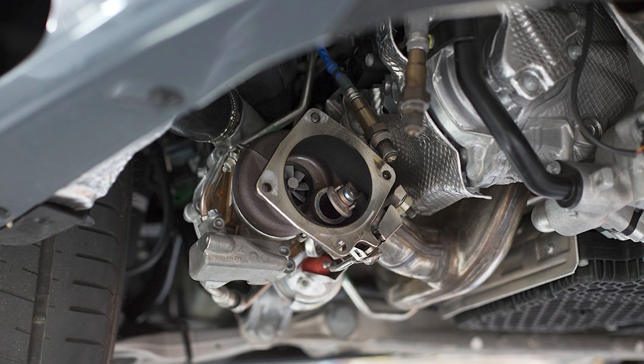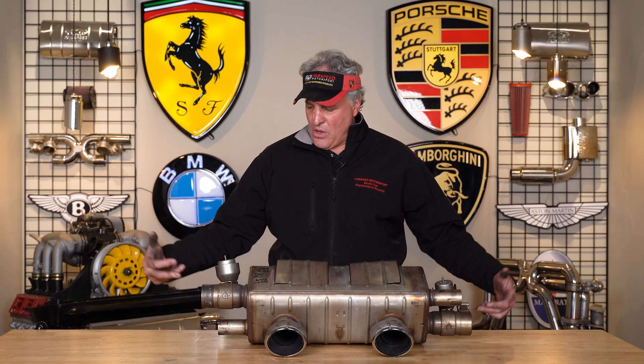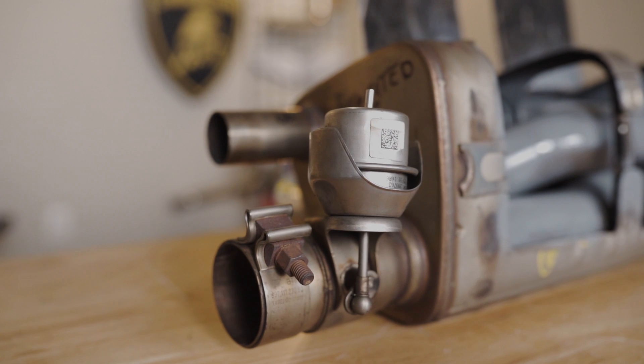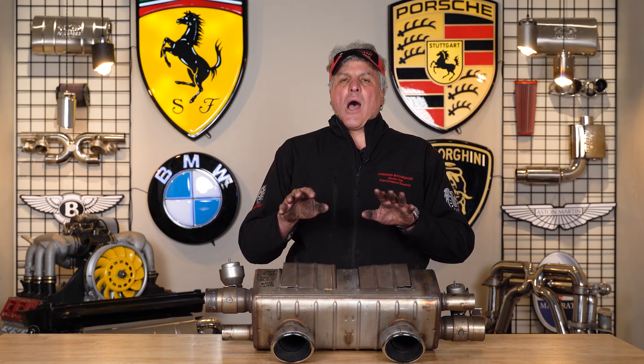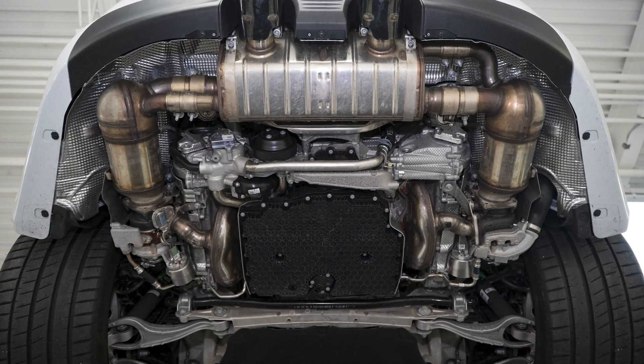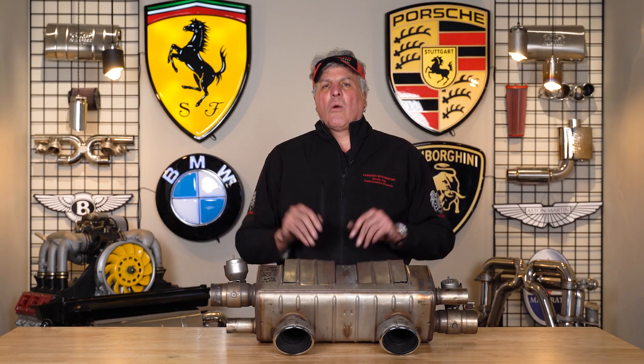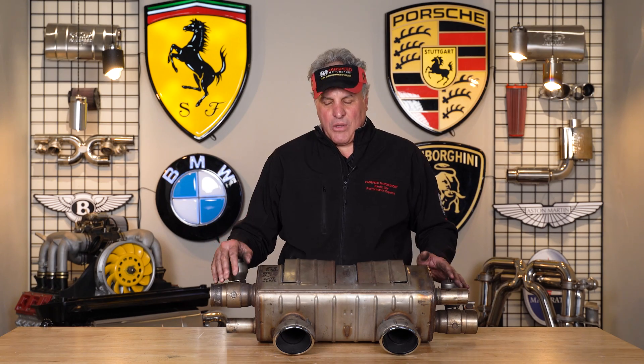So exhaust — let's say my shoulders are the turbos — it goes through cats, then it goes in where my fingers are on each side. There's a vacuum valve on each side, and when these vacuum valves open, the exhaust goes in here. There's a lot of magic — or pseudo magic — to keep this car grocery-getter quiet, really tame, in case the guy who buys the 911 just wants to have a Porsche — you know what I'm talking about, those type of guys.